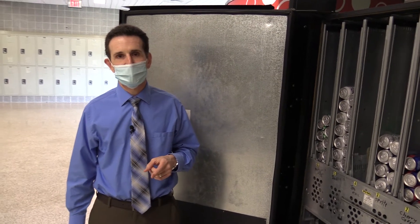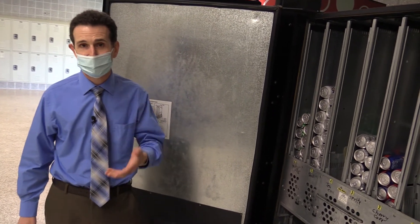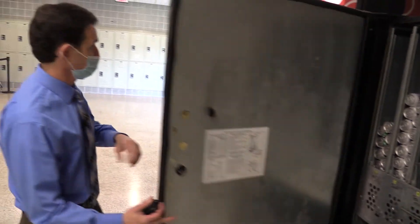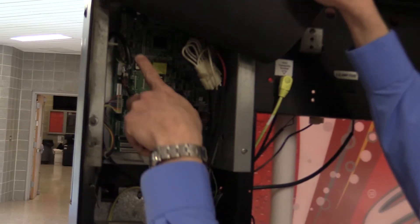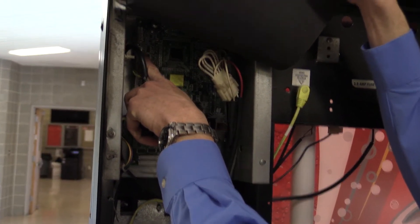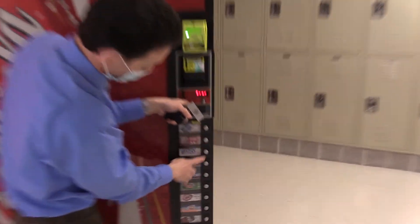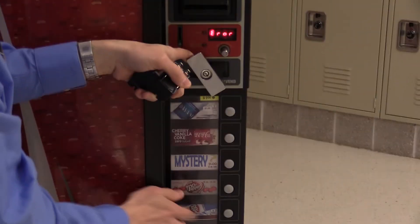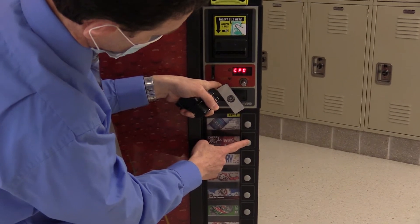So if you think you might be having a relay issue on your machine, there is a way to go into the control board and test your relay. The way you do this on these G3 machines is you come up here — this is a newer board. It has the small blue button to go into your programming mode. Press that button once and then go to the front of your machine to the displays. You navigate through everything with the first four buttons of the machine. I'm going to go up until I get to Test.